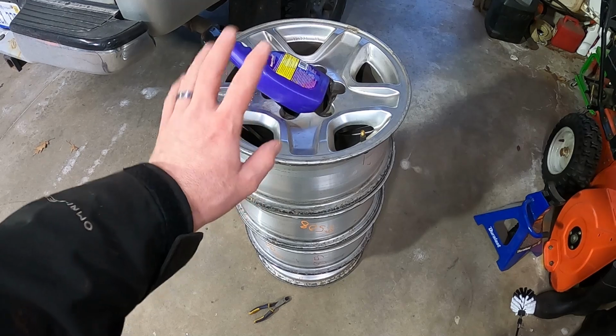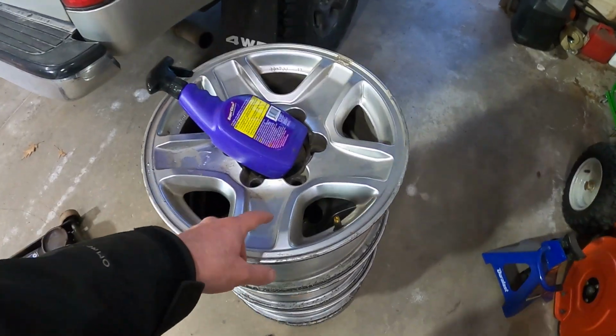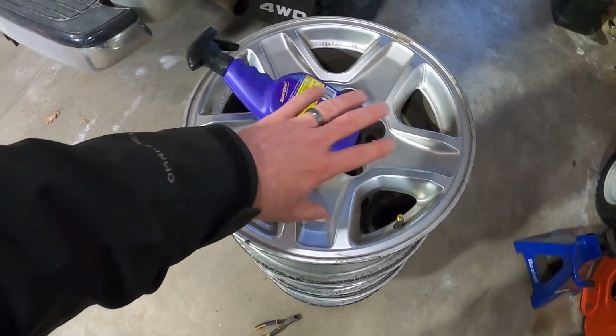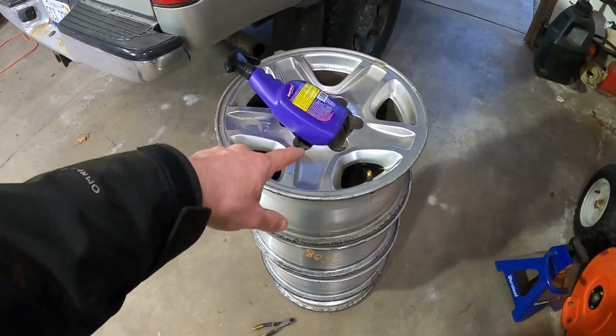Okay, went through the other 3 rims. Everything looks good. They seem to spin nice and true. So now what I'm going to do is pull the valve stems off, pull all the weights off, and then degrease, and then wash them all down. And then I think once we get to that point, we can throw some aircraft stripper on there.